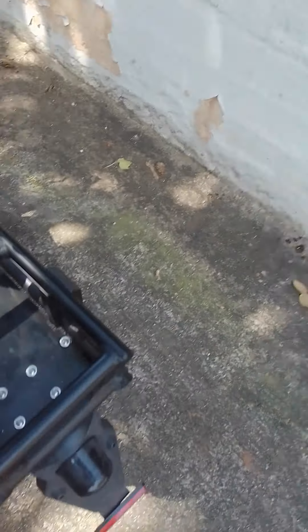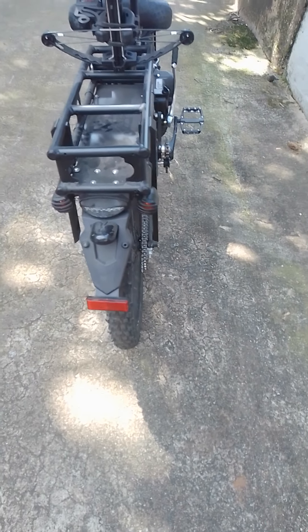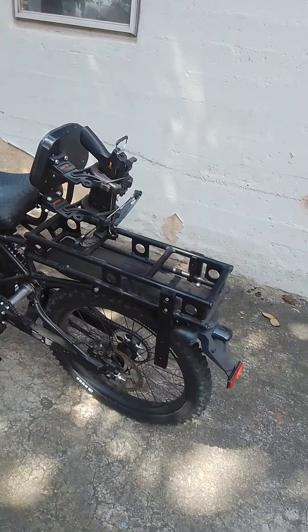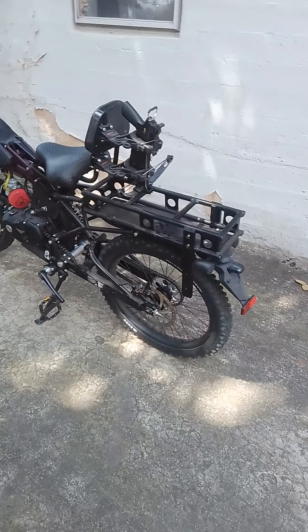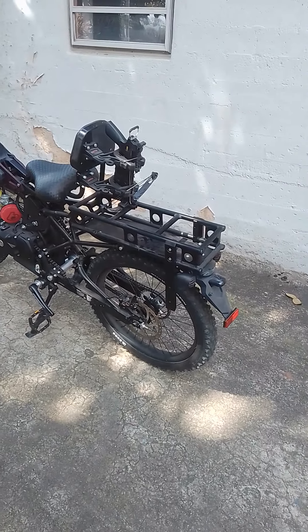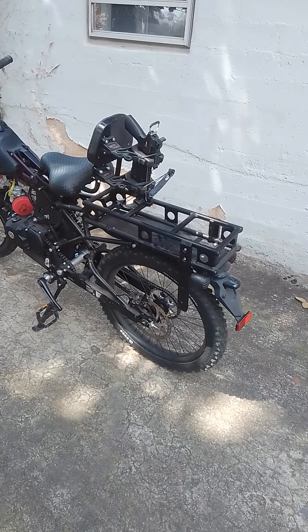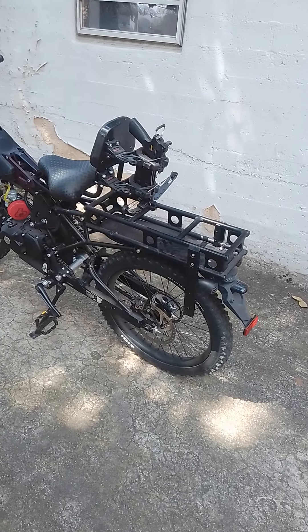You can turn the running lights off and the blinkers — you can see my other bulb's blown out so I need to get another bulb. I was messing with that forever and then I just cut the line at the back, hooked up a test light bulb, and it blinked, so I'm assuming that's the issue — it's a bad bulb.